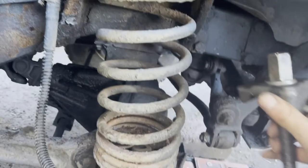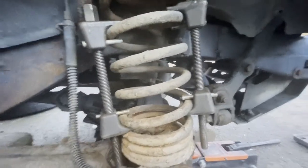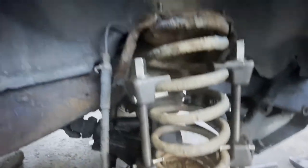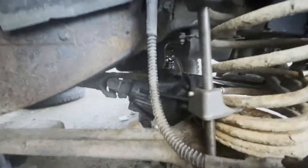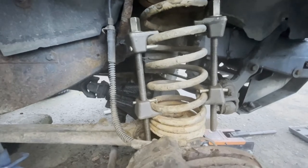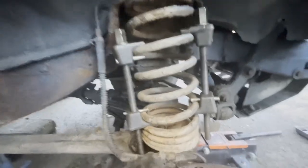What I usually do is with the body jacked up, I'll let the axle down as far as it'll go — that way there's more space between each coil of the spring, which means you can fit in your spring compressors more easily and it speeds things up. Once you've got your tensioners on each side of the spring, ideally you want them completely opposite each other so it's even, but it's not always entirely possible because you need room to reach the part you have to turn. I've done this a few times now and it's worked each time, so I'm not too concerned.